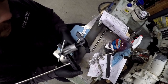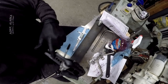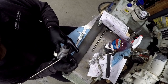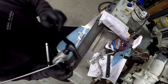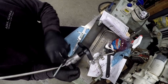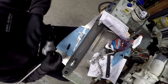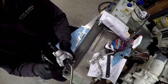You get it positioned where you want and slide this down. It has some marks on the flaring tool right here to locate the side, so it'll drop into its corresponding hole and be positioned correctly. That looks good — just tighten this down. You can see that's out of the way, so we're just going to tighten this up now.